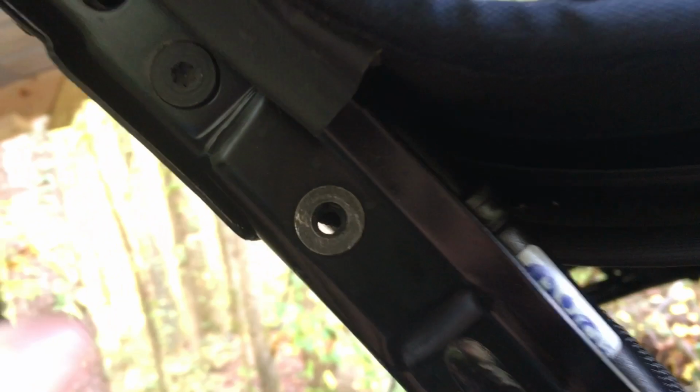And when you get this loose all the way, there's a screw right underneath there that I'm going to show you in a minute. I forgot to take it off, and I was trying to pry on this like an idiot. Anyway, I'm showing you right here, you've got to reach inside the headliner, and there's 6 screws that go across the back of that, and end up in the back side of that metal cover I'm hanging on to right there in that video.